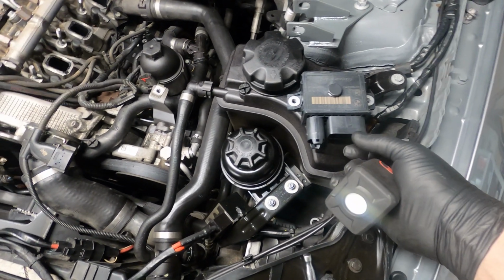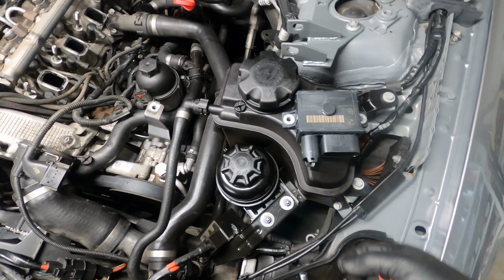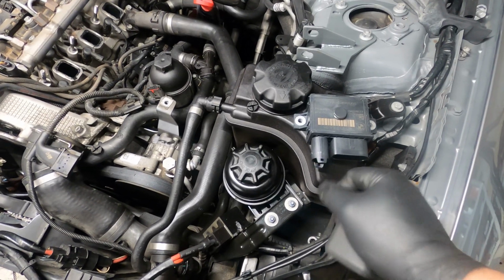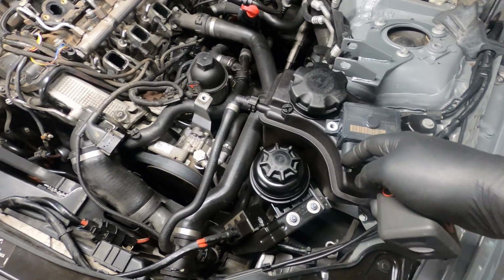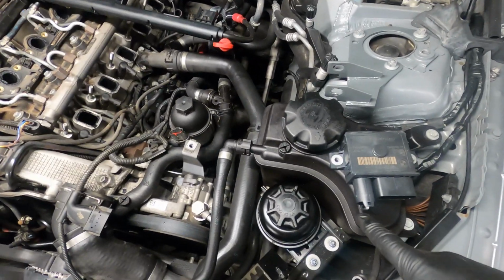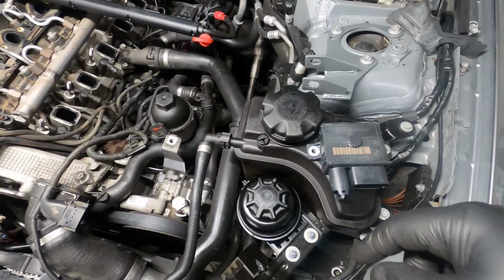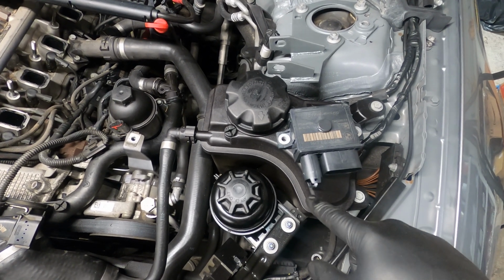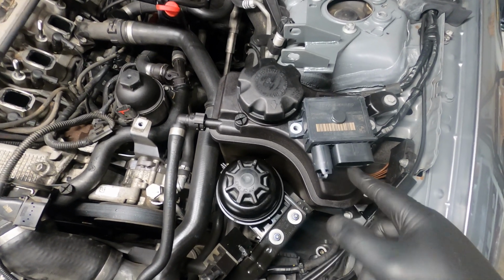And then your plug connection here on the bottom, this bigger one, is 2 pinch tabs. The one on the back is a little hard to get to, but you can reach your finger around behind it, pinch it, and pull it off. And then this one, there's not really any tactful way to get this off other than just pulling on it. In lieu of pulling on the wiring, because that's not really a good idea, from up top you can actually look down and see there are ridges in this connector where it plugs into the bottom. Stick a screwdriver down in there and bump it with the back of your hand, and it'll knock this connector out of the glow plug controller. It really just has a little bit of tension on these 2 little tabs holding that connector in.